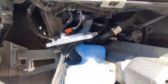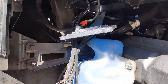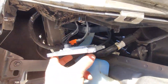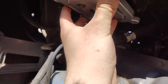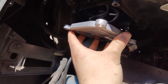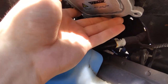Back at the ballast — this is the new one I bought, a knockoff brand from Amazon. A guy in the comments said it worked on his MKX, so I'm hoping it'll work on the MKT. It was also a 2011; this is a 2010, so hopefully it'll work. If it doesn't, I'll just return it to Amazon. It clips back in easy — remember it goes back in that direction. The old one went that way but the new one's going to have to go this way — shouldn't matter at all. Knockoff brands, you never know.